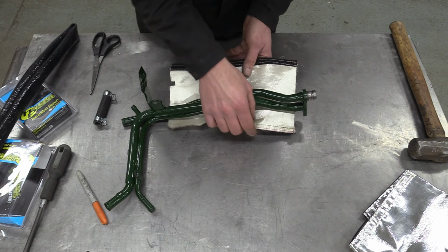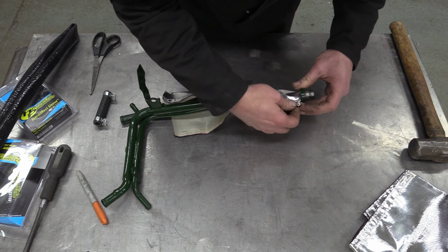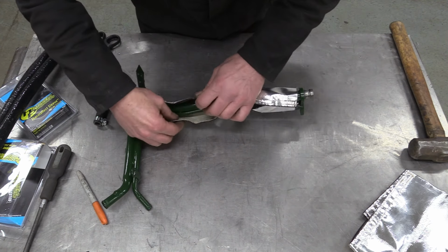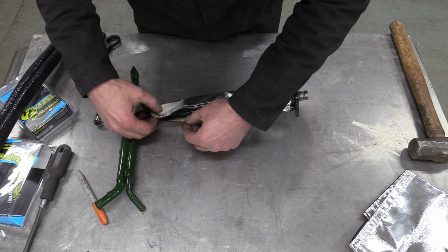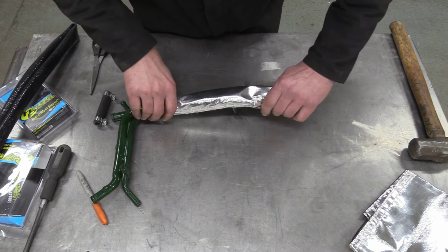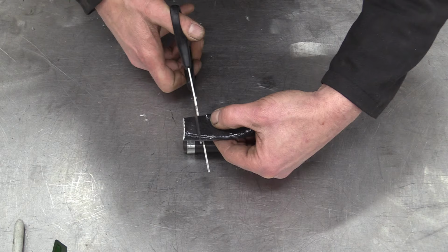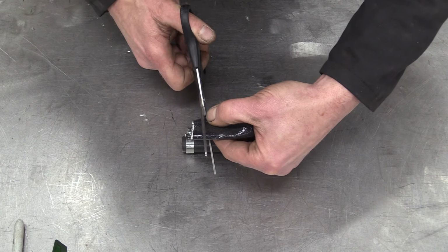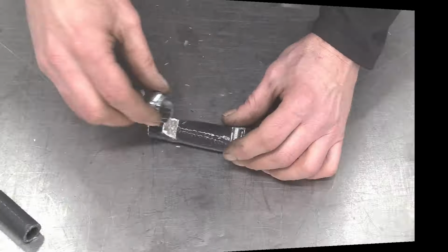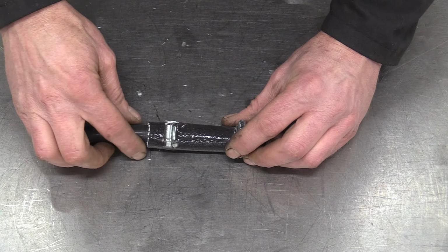Because of their location, we thought it prudent to insulate them from the heat of the turbo by wrapping them in some thermoflect hose sleeve. This is easy to install, and if nothing else, we'll protect the lovely British Racing Green paintwork. This little silicon joiner hose is also in a vulnerable spot, so it too gets some heat management treatment. We're expecting the underbonnet temperatures to be pretty sweltering, so the more we can do now, the better. More on that in a few minutes.